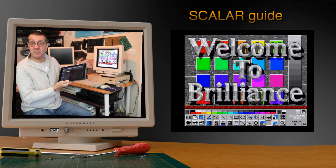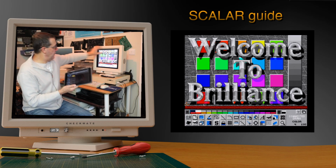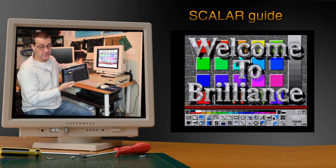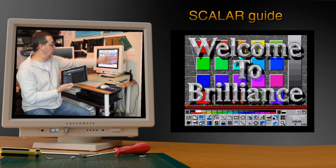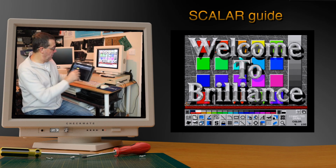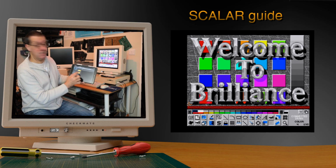It's because now this is where you have to understand the old machines. This is overscan, okay? So it's black. There's nothing there. This display is just in the main. If you want to put it into overscan, you can select overscan and it will use that area. So the monitor will scale it to fit. But this will allow me to move it. So if you watch that there, you can see it moving.